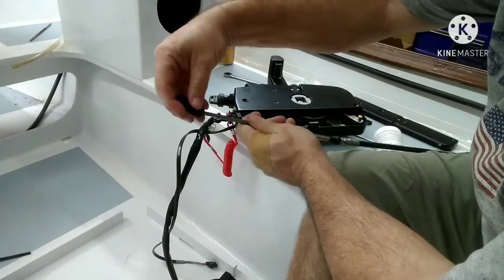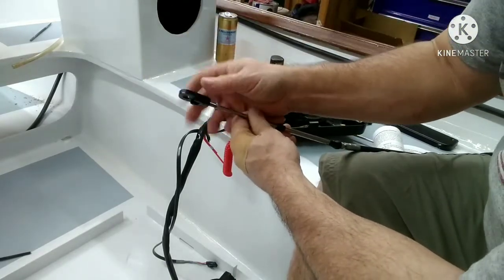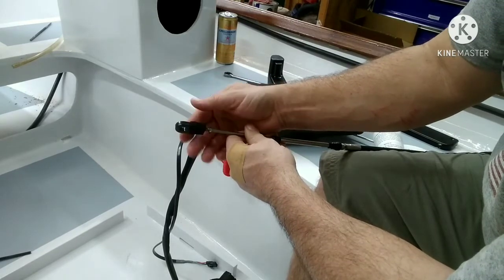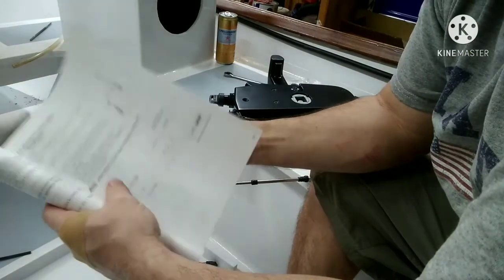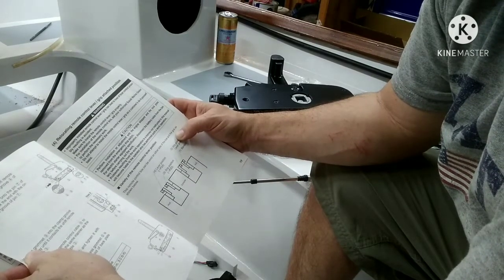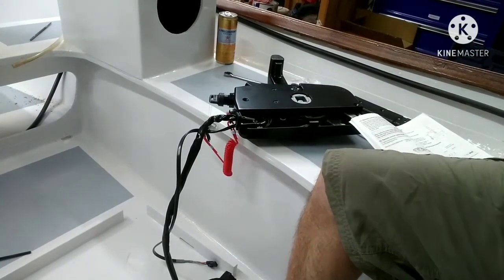Both ends of these cables are the same, so it just says thread 11 to 14 millimeters. And that looks like it's about 20 millimeters long, so somewhere in there. It's going to be 11 to 14. Insert the outer groove of the shift remote control cable into the clamp groove 4 of the housing. Next, fit the cable end 5 onto the pin. Let's get this cable.